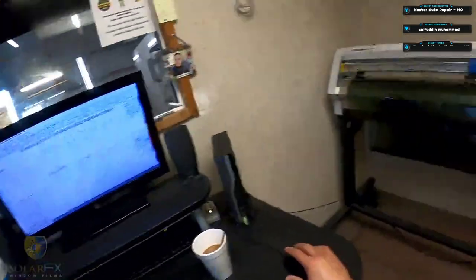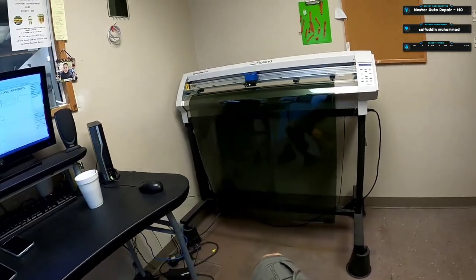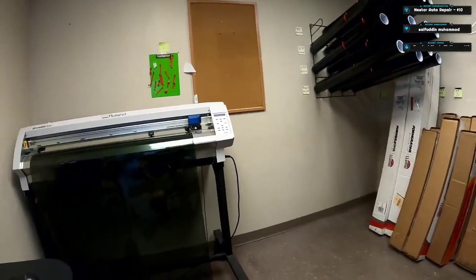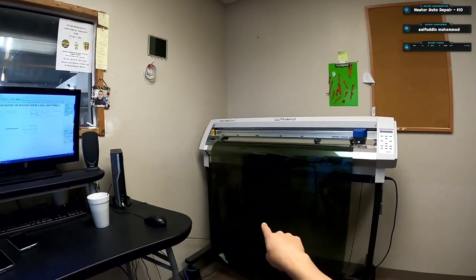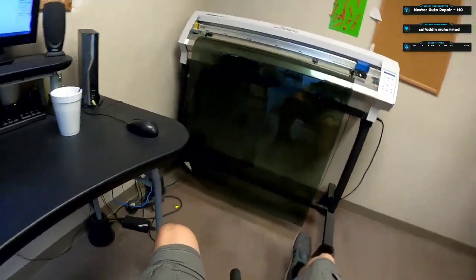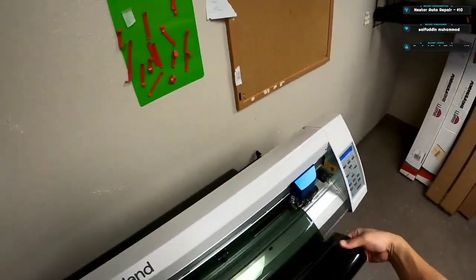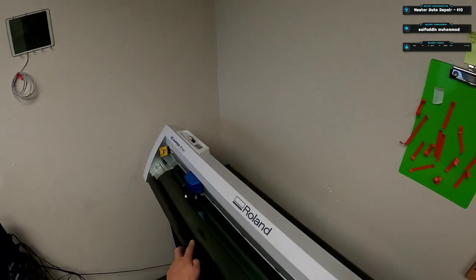Looking good. So it's like a tinter superstition, like you never put the box of film away you're working on until you're done. So I have 30, but then I have to do 15 on the back end. A lot of superstitious tinters figure that if I take this off now and put 15 on, I'm almost guaranteed to mess up one of these windows, and then I'll have to take the 15 off, put the 30 back on, and recut it. So out of habit, just in case, I'll go ahead and cut these and install them. That way, if I mess up, or find out I do need to shrink it, or have to redo a window, the 30 is still on here and I'm saving a little bit of time.